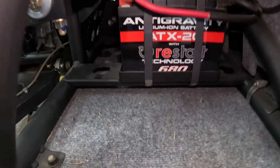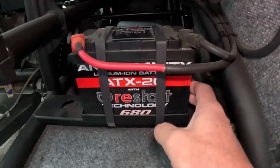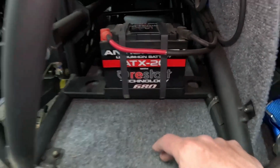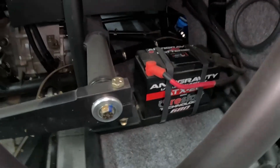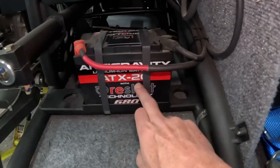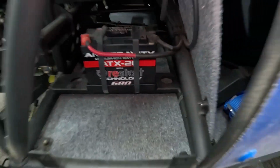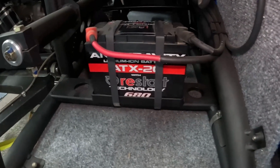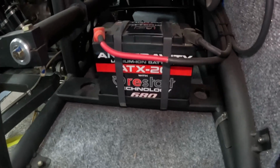So Wratchet has this lithium battery tucked away back here. It's pretty small, super lightweight. But lithium batteries, when they get cold, their voltage goes down a little bit. And this battery actually has a BMS, or battery management software, on it. When it senses the voltage gets too low, it just cuts the battery off so that it never lets it completely die. And what happens is, in cold weather, and when I say cold, I'm going to say under 30 degrees, maybe 35, I'm not sure.